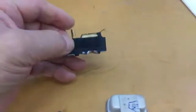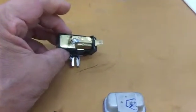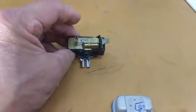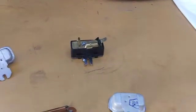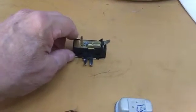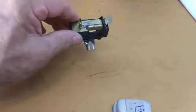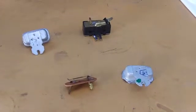The regulator type has an internal zener diode that does the controlling. Sometimes there will be a light bulb inside, other times a big resistor called a load device or load component. When you order one from any of the vendors you're going to get 5.1 volts. That 5.1 volts has to go with the old style original fuel gauge, which is going to be about 18 ohms. If you use the non-OEM aftermarket fuel gauge with this 5.1 volt regulator or vibrator, you're only going to see about a half to three-quarters of a tank. We're working on that issue and hopefully will have a solution soon.